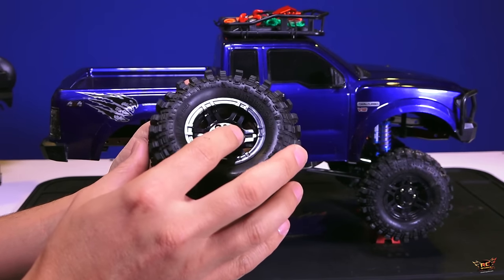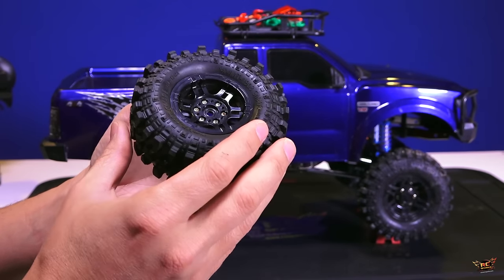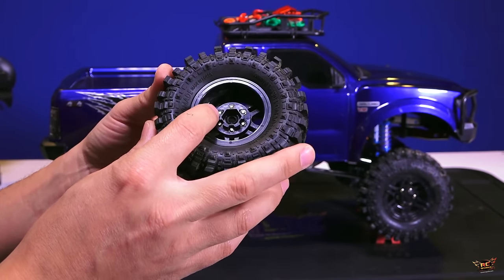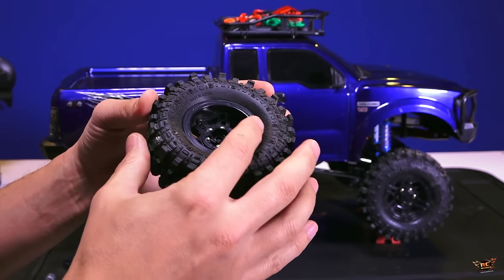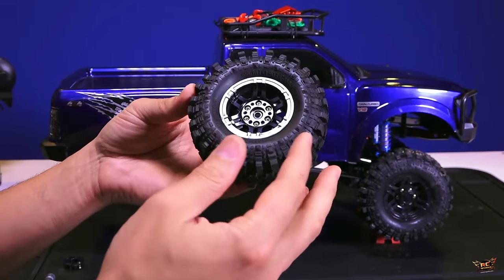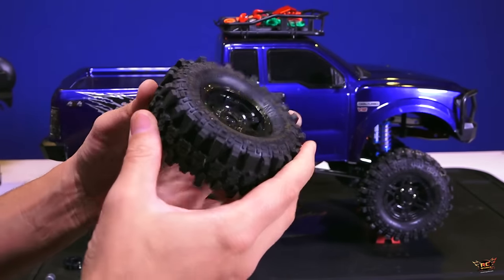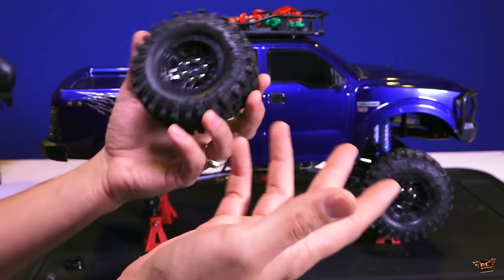A small tip: if you want, you can go ahead and put a small bead of silicone around the inside of plastic beadlock tires. If you're worried about stripping out the holes or not having a tight enough seal to keep water out, run that silicone bead around. When it's dried in about 24 hours — or sooner in a warm garage — and you need to change your tire, you can just pull it off. The silicone comes off and the seal is broken. I did not silicone these tires today simply because I don't have any here.